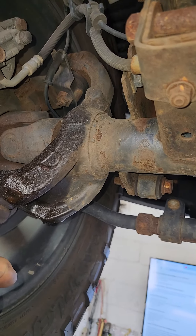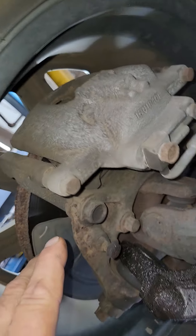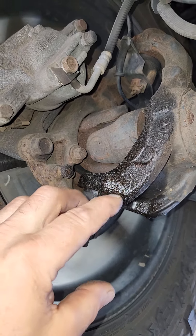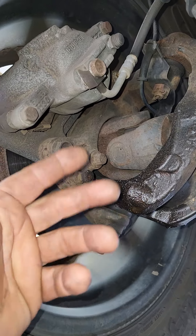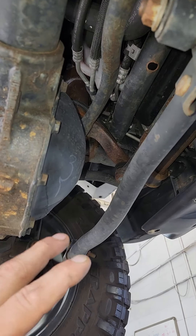this is a job where the brakes have to come off — and these brakes are just about shot as it is. You have to get the hub bearing out, and chances are it's going to be destroyed. So new brakes, new rotors, new hub bearing, and then you need to open up the differential, get the whole differential in here, get the axles out. The seals are inside the diff.